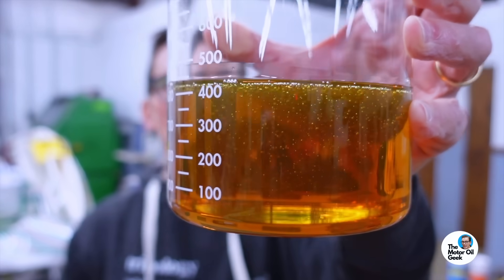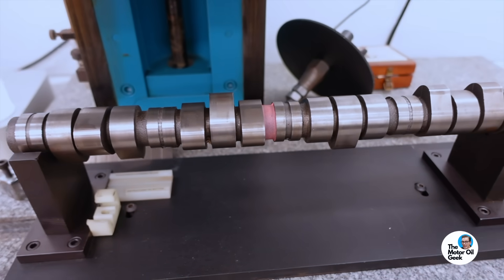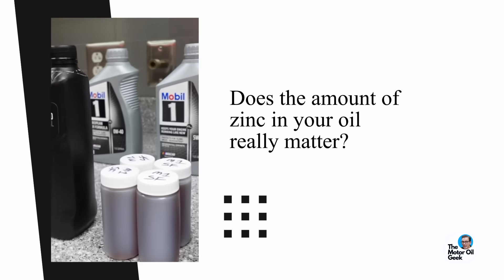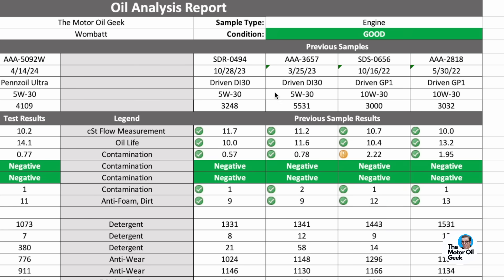That first fill with the Pennzoil Ultra Platinum — the wear rate dropped a little bit. In fact, the Pennzoil Ultra Platinum did an even better job than the Driven GP1, which in a flat tappet engine has provided the very best wear protection I've ever seen in flat tappet wear testing. But as I've mentioned in the video about zinc, different metallurgies and surface roughnesses respond differently to the same chemistry. This engine — being Nikasil-bore, not Alusil or a normal iron bore — liked the DI30 chemistry better than GP1, even though in a small block Chevy flat tappet engine those results would have been opposite. Application dictates chemistry, not the other way around.